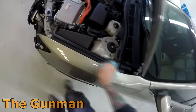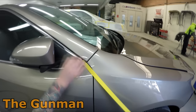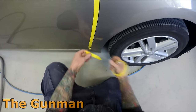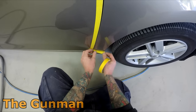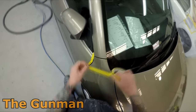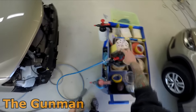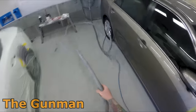Wiping those interior edges helps during the final clean-down and masking stage — there'll just be a little bit of dust for a quick wipe, rather than mud and dirt. I'm going around these edges with three-quarter inch tape — 18 mil tape. You can use two-inch or 36 mil if you like, but I'm confident with the orbital sander that I'm not going to be hitting surrounding panels with just 18 mil on there.